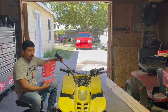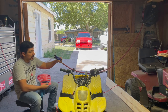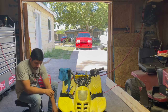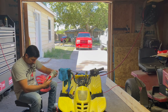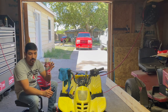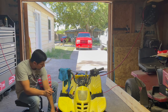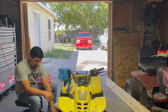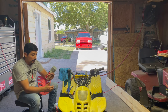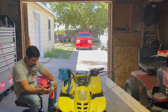I'm about ready to start painting these ATV plastics. First thing I'm going to do is take an air gun and blow off any dust I created when sanding. Then I'm going to take a wet washcloth and wipe them all down. I'm going to paint all this outside and blow it off outside, but then I'm going to take adhesion promoter — if you don't use this your paint will start peeling off your plastics right away. I'll do one coat of that. It's kind of expensive, about $10 a can. For filler primer I'm going to do two coats — also about $10.